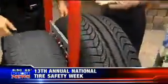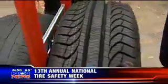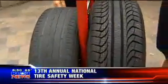So John, how often should you check your tire pressure? You should be checking tire pressure about every month to six weeks. And why is that? You're going to increase fuel economy. But why do you have to check it? Because tires are porous, they lose air. They're not a natural rubber, not because you have a nail. Your tires will lose about a quarter of a pound, maybe every month. So if you don't check it until you change your oil, you'll roll in with 18 pounds of air.